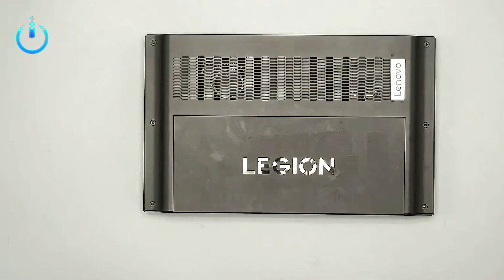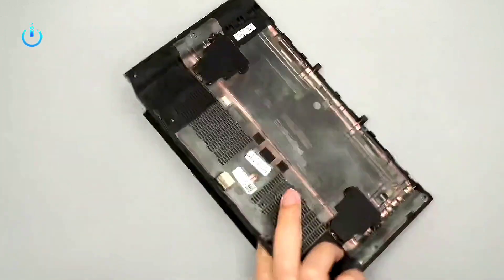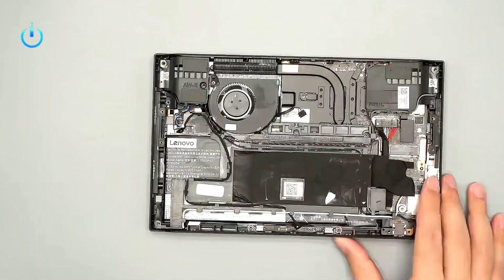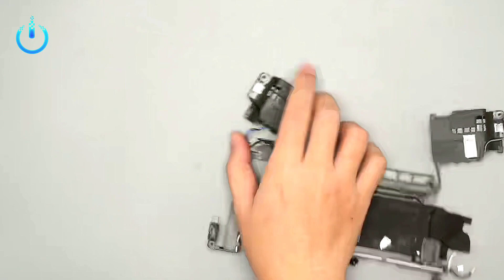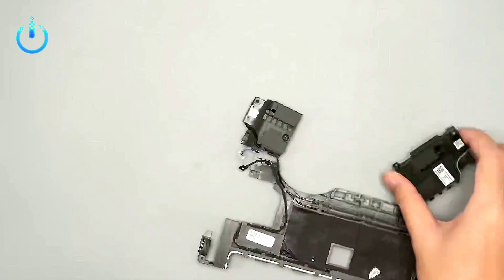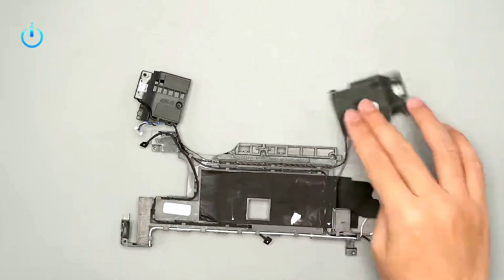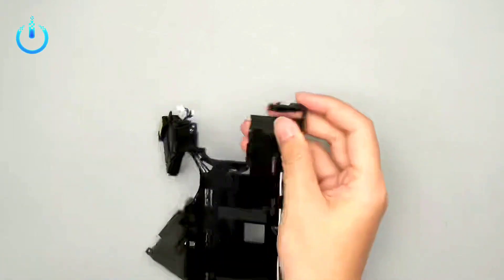The back cover of the device is made of 30% reinforced polycarbonate due to the detachable handle design, so it comes with a bracket on the back cover. After removing the case, the first thing you see is the PC ABS plastic stand. There is a speaker unit on the top left and top right, which is also responsible for the Wi-Fi antenna.